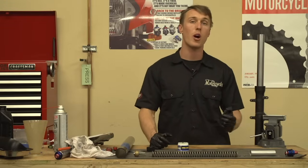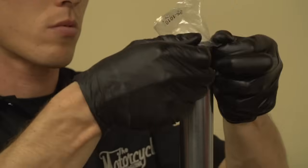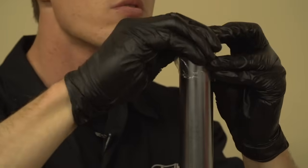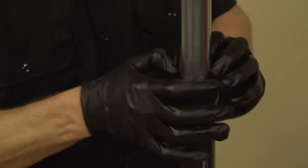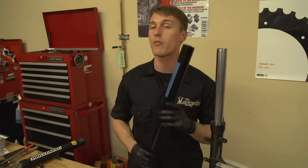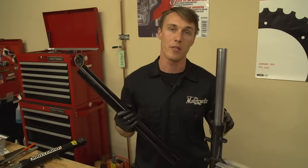Once you've driven the bushing home, you can leave the washer in place and it's time to prepare your oil seal. Lubricate the inner lip liberally with quality grease, then slide it over the top of the fork tube. Covering the tube with a thin plastic bag will ease installation and help avoid damaging the seal lip. Press the seal in as far as you can with your fingers, ensuring that it's square in the bore. To drive the seal home, there are plenty of purpose-made tools like this fork seal driver, but a lot of people use PVC pipe to fabricate their own, and it just so happens that this inch-and-a-half ID ABS pipe is a perfect fit for the oil seal on this CBR fork.